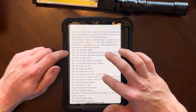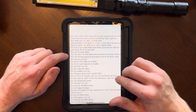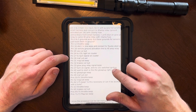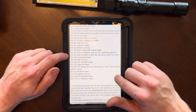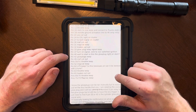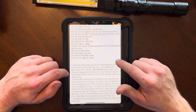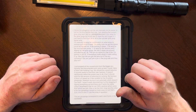This reference was for a Toyota swap and he kept the OBD2 port - you do want to keep that. It shows you everything you keep and everything you don't. Pin 37 again - your ignition switch, you have to have that. He kept his glow plugs. You've got to keep all your throttle - all the wires I showed you for your throttle, you have to keep all that.